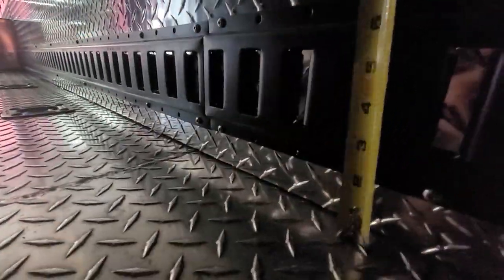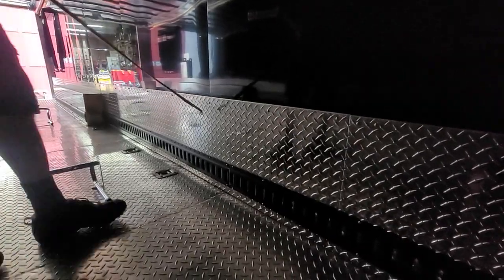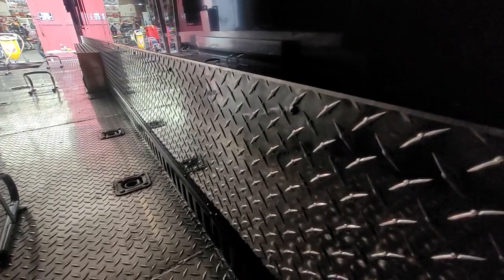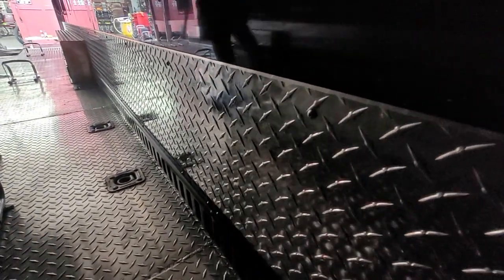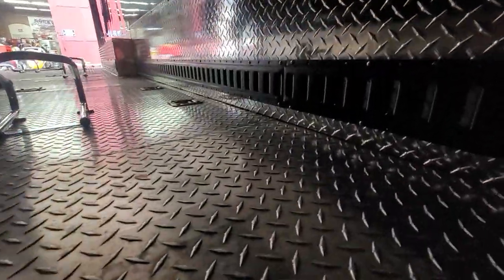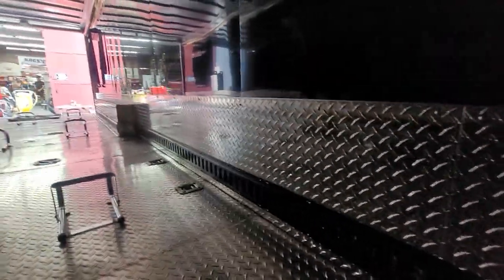How far is that off the floor on this side? It's two inches on the Cobra Coach — it's got a two-inch trim piece. So that would work out — anything two or three inches off the floor, just like this black e-track. And how tall do we go on the diamond tread plate? It's 19 inches on the wall. That's perfect for motorcycles, and we've beveled the top edge. This is the thicker diamond tread plate — not quite three-eighths but much thicker than standard — to give structural rigidity when you get a heavy Harley clamped in here. So the first row goes two inches off the floor.